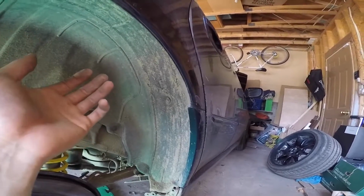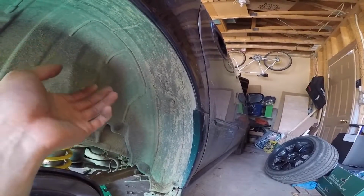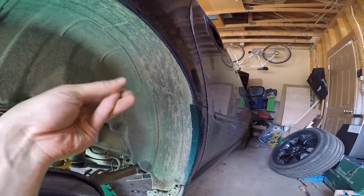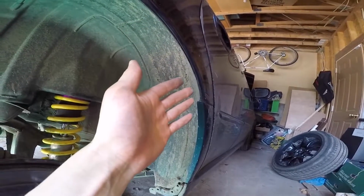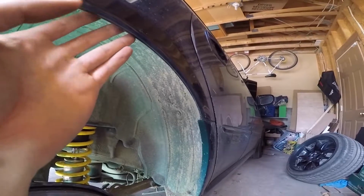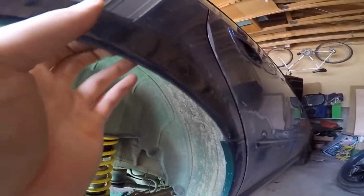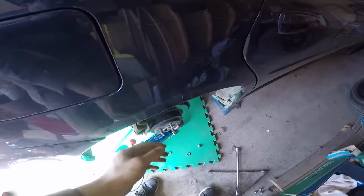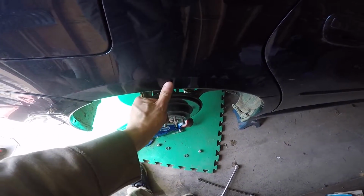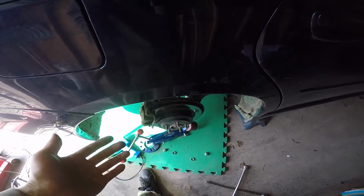There are other ways that are seen as not as proper, like using a pole or a baseball bat. I don't really recommend those because you can't get the consistency. And I know a lot of people pull their fenders with a fender roller, but I don't recommend that either, because when you pull it with a fender roller, the edge of the lip on your fender actually curls out, and personally, I don't really like that look.